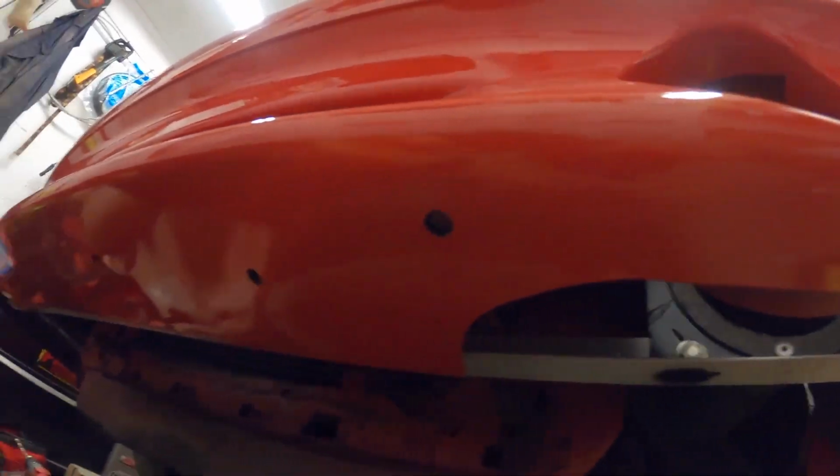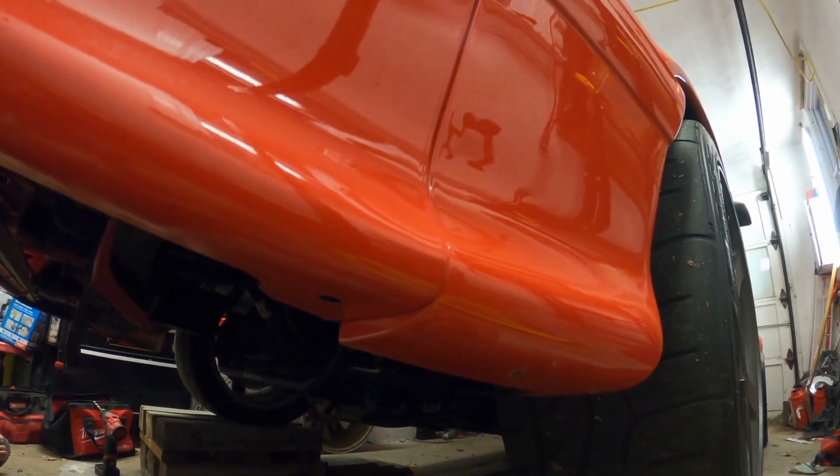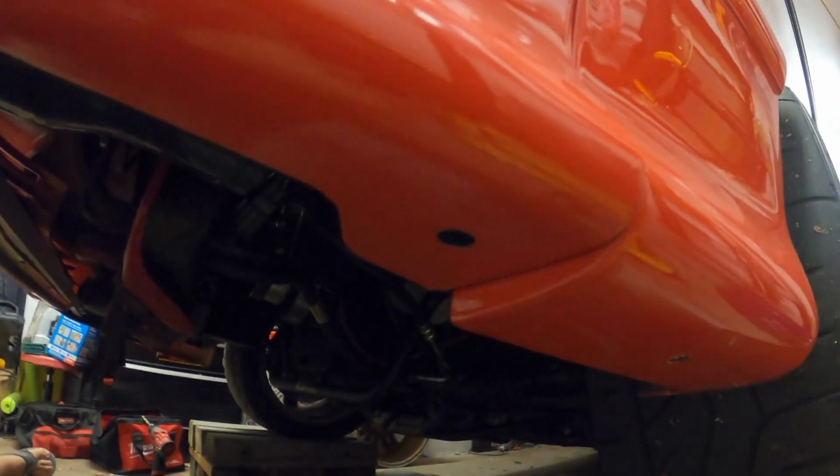Well, there you have it. All the holes are drilled. Now this is an aftermarket bumper cover, not factory. Not even factory paint, which is why I used that beautiful pink paint for delicate surfaces because my car is a delicate little flower. This is the Cervini's bumper extension there. You see it doesn't quite line up, so we have a bit of a gap there. This is also made out of a different urethane than the factory bumper, so it drills a little differently, as you can see. And again, since none of this is OEM, you can see over here, even though everything was lined up, yeah, a little bolt hole there, a little chewed up. Wasn't exactly getting a lot of meat on there, so we'll just have to make that work. But such as aftermarket parts, same thing right there. Well, we will see how this thing looks. Hopefully not terrible.